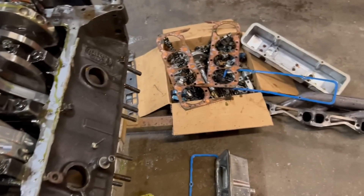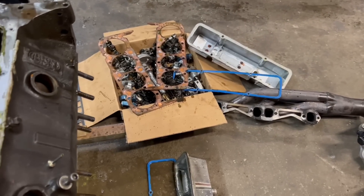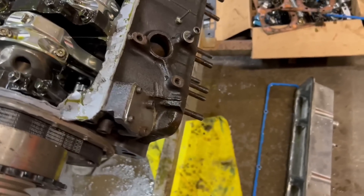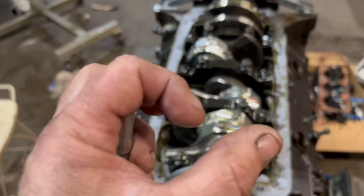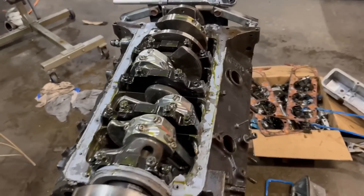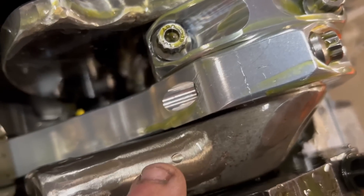We are making progress. Everything looks pretty good. Head gaskets — I don't really see any issues. The o-ring wire is a little bit flat from use, but the lifters look fine. They all pulled out easily. When lifters mushroom they're hard to get out of the bore — that's when you know you've got a problem. These all slid out with no issues, so we're good there. I just loosened all the caps on the rods and they're labeled — number one right there.